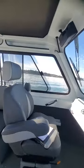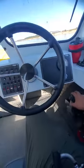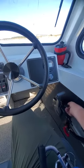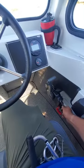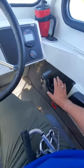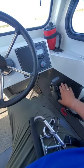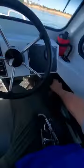Look how nice those sliding windows are - you got little trays, grab handles. You can open that window up because it's actually pretty warm. On a cold motor, pump it about like this back and forth three times, bring it back, lift this lever here until you feel a little friction, push and turn the key. Keep it pushed in - if it acts like it's going to die, push it again. Once it starts, idle's going to go a little slow. Give it maybe 30 seconds to a minute, you'll hear the RPMs go up, just drop it down a little bit. They may go up again - just drop it all the way down and you're ready to go.